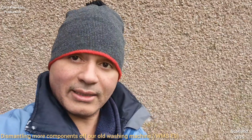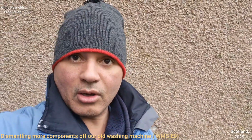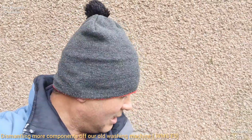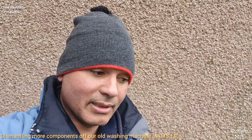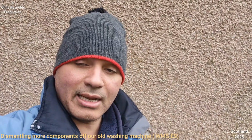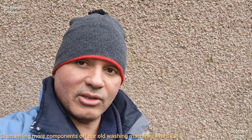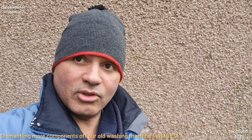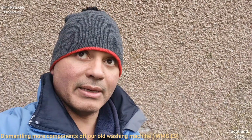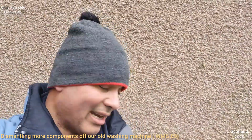It was brutal to break into it, but as I say, this machine's finished, it's scrapped, and I'm just learning from my own curiosity and then sharing it with you. So that satisfied me to know for certain that there's no mechanisms. There wasn't any evidence of any pivots or mouldings for pivots to allow any flaps to operate to get the softener water in. It's just a simple case that two jets would collide and then form into a centre jet, causing the water to go through that centre water channel.